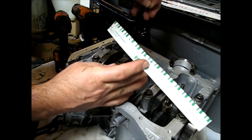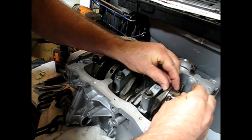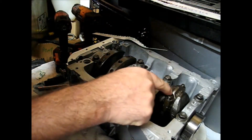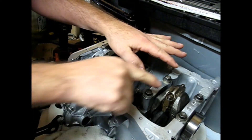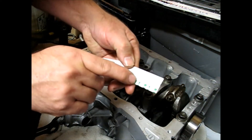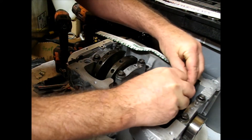There are millimeter and inch readings on the gauge. You cut a piece to the length you want and out comes the filament. You put that on there, then put your main bearing cap or connecting rod bearing cap in the correct direction and orientation. Tighten it to factory spec and see how much squish you get — the more it squishes the wider it'll be, the less it squishes the narrower. You match that width to the inch or millimeter scale to get your oil clearance between those parts.